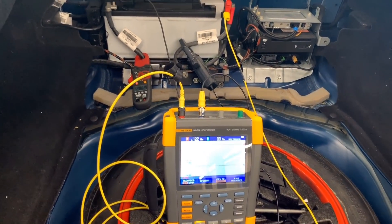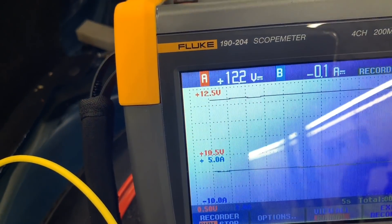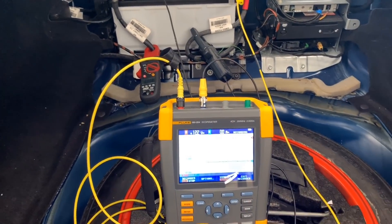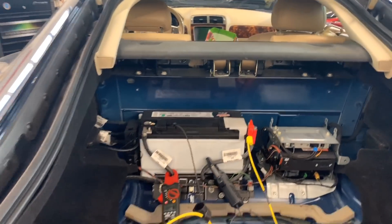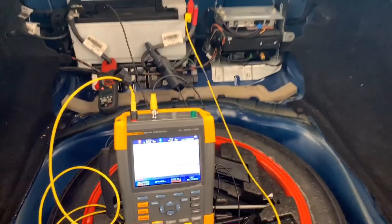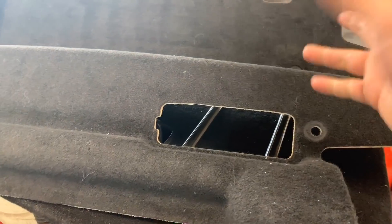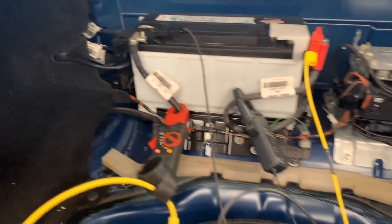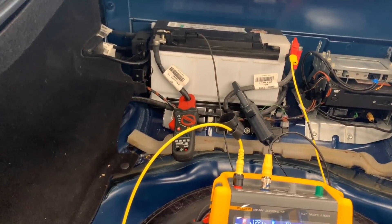I'm waiting for a huge spike because to drain this battery it has to be something big. As you can see, the battery voltage is at 12.2V, which is okay — it's a very strong battery. The car starts and runs fine. The battery is in the back, in the trunk. You need to remove the spare tire cover and then this cover — it's just four plugs that unscrew. There's also a DVD player at the back, which was a concern as a possible drain source, but everything looks original.